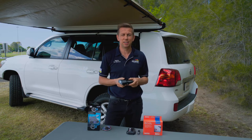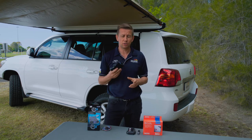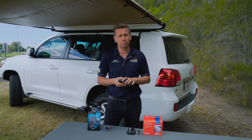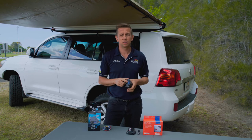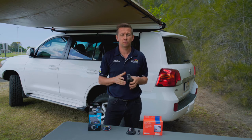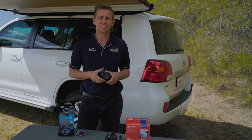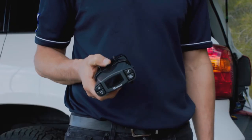Because of this it can be positioned at any angle up or down in the vertical plane. Some of its cool features: it can control up to four braking axles. It is removable with a snap clip and plug on the rear, meaning that if you do have two different vehicles you can run wiring on both vehicles and swap the controller between your cars. You can change colours on the LCD screen to match your interior dash lights. It has five different pulling trailer options and multiple preferences for different drivers. You can select between electric or electric over hydraulic braking unit mode, and you can also go into an easy-to-understand diagnostic mode which shows you output, current, battery voltage and the brake current.